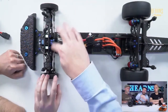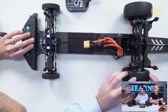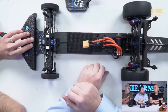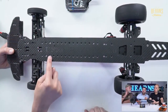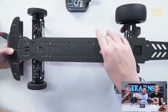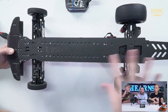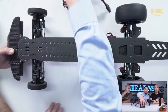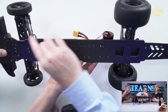In the dry tire cars where you're not using an artificial sticky, the further back you put your weight, the more weight you have over the rear tires, increasing traction. On the base of the chassis I notice all these holes - they were designed to move battery mounting points up and down, but they're heavy and unnecessary at this level. There's nothing on this car that doesn't need to be there. Instead, I use a product called Dual Lock - it's Velcro but better because it's the same on both sides, so you only get one roll.